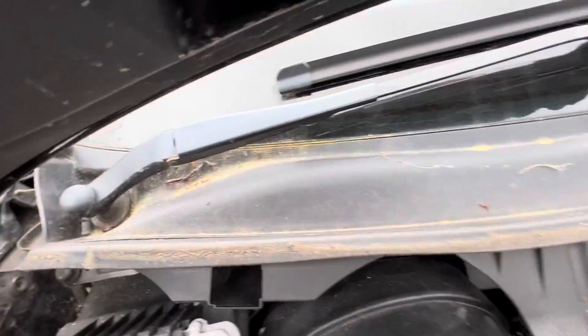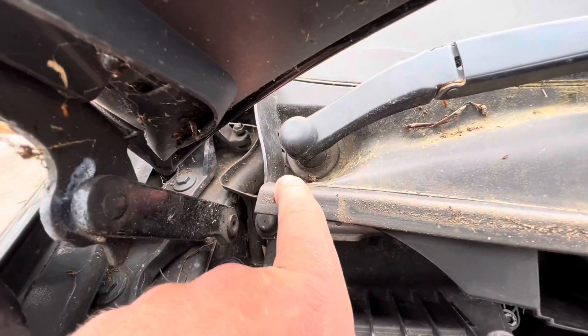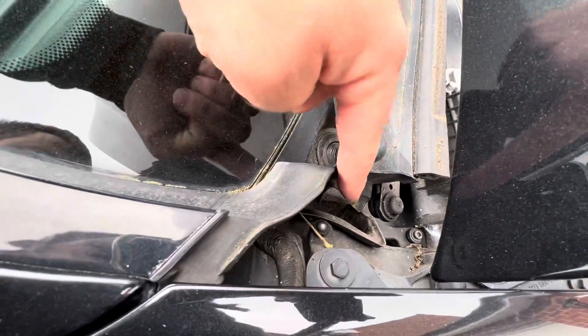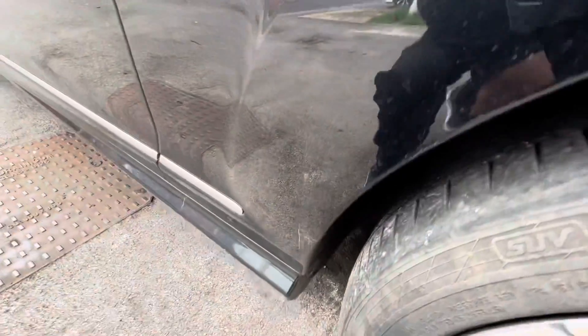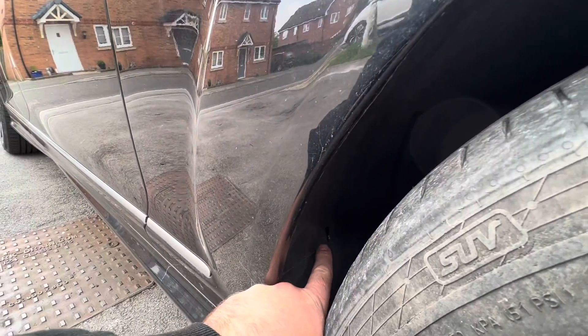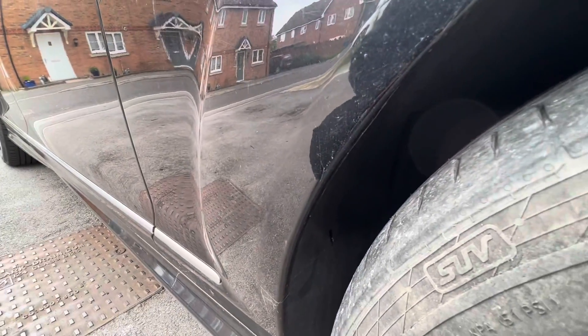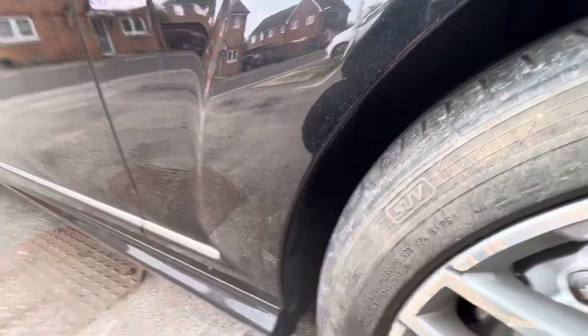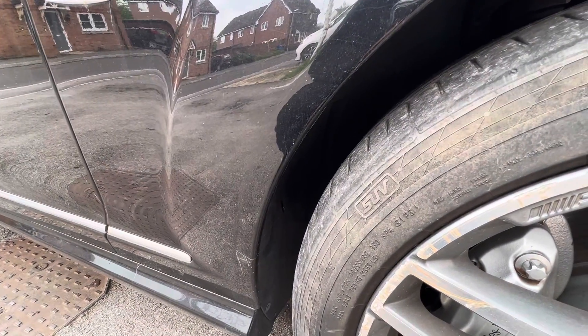When we look at the scuttle down this side, there is also an exit into a drain tube. It goes down the side here and should come down through the wheel arch through this drain here. It's quite common for these to get blocked. So let's get these wheels off, get the trims off, battery out, and I'll catch back up with you in a second and show you where we go.